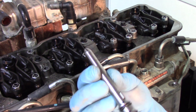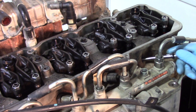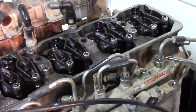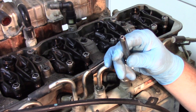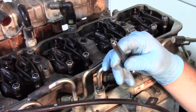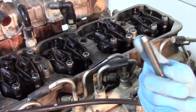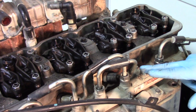Unfortunately, with these feed tubes you can't just rotate it to get a fresh seat, because it is a keyed component — that little notch only goes in one way, so you can't rotate it to try for another seat. It is recommended to replace this every time. However, if you don't replace it and after installation you find no pressure, low pressure, or a misfire on that cylinder, go back and look at this tube. It may not be seating like before, and a new tube may be the simple fix.